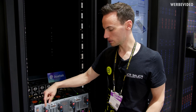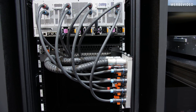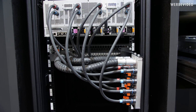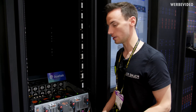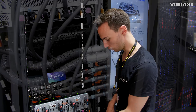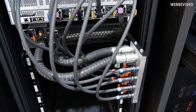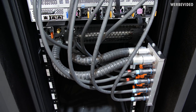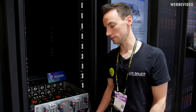Both blocks have an individual pump, so the water goes through and then flows down here where we have two big pipes going into a second rack sitting underneath, which contains a very massive radiator. It's similar to a typical open water cooling loop but much larger — this radiator is capable of providing 6000 watts of cooling, which is quite a lot. You can also see the cold distribution plate, a heat exchanger plate, where those blue and red connections go, with two massive pipes providing cooling through the radiator.